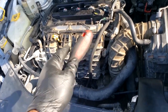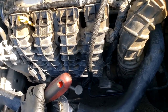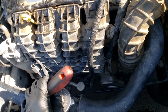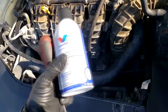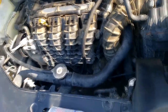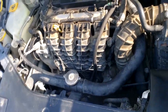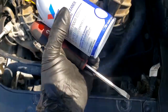What I think is causing the no start is fuel. That's the easiest one you can basically simulate — you can create an imaginary fuel presence. You can spray fuel down the intake just in case you suspect your pump isn't doing what it's supposed to do. The car was dead so I had my jump box down there, jumped it off, and found I'm just spinning over — sounds like it's not getting any fuel.